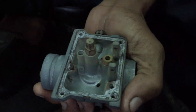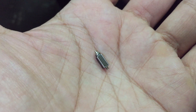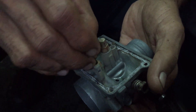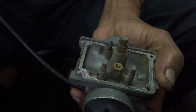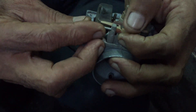This happened because of not starting and riding my motorcycle for the last few months. It's a two-stroke engine and the 2T oil in the carburetor blocks something if the motorcycle is not used for a specific period of time. Iron rusting inside the carburetor along with other waste particles becomes the main reason for blocking of the pilot jet. Even the smallest particle can block the pilot jet.